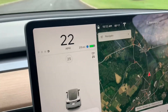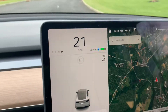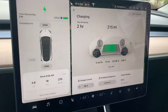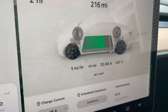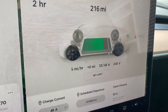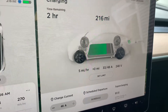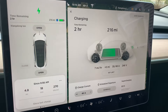This just illustrates the regen capability. The way it feels when I drive is no different than the car cruising. Now I have the car plugged in and it's started charging. You can see it's only adding about five miles per hour — the current is 33 out of 48 amps. At 33 amps I can probably charge about 30 miles per hour, so it's definitely not charging the battery as it should — the rest of the energy is going to warming up the car. Let's keep charging for a few minutes to see what happens to the regen capability.